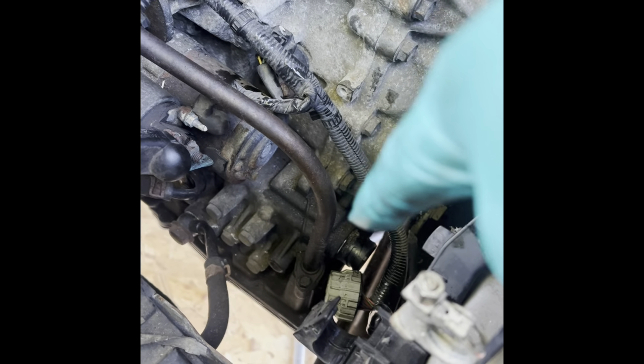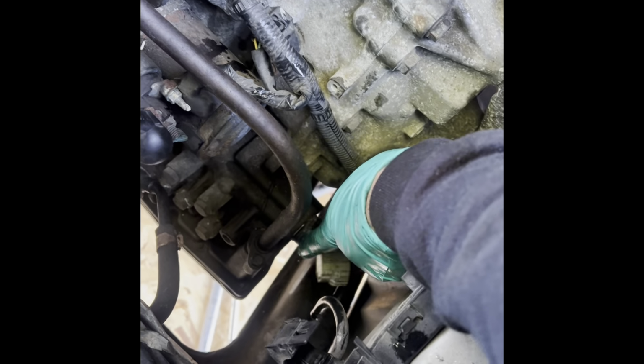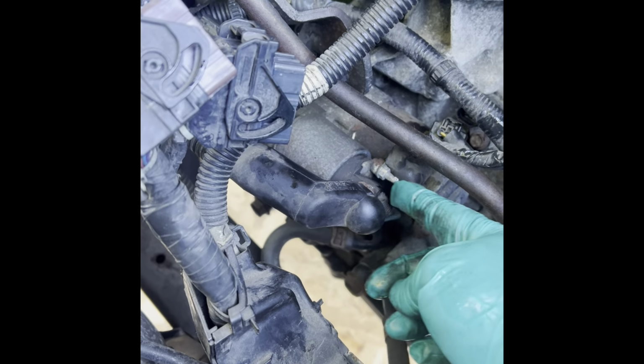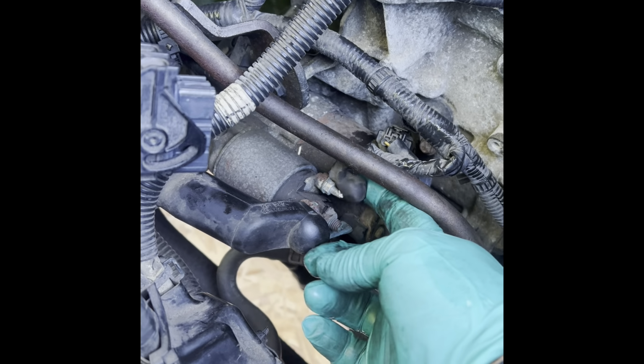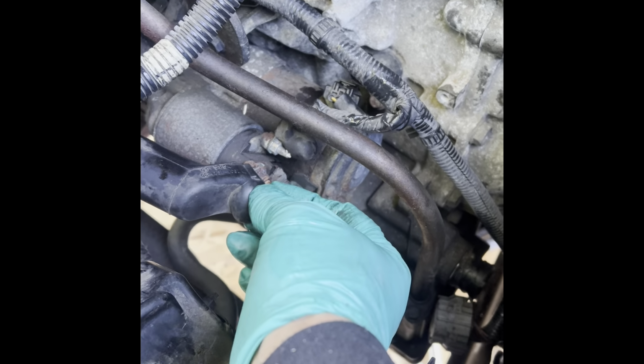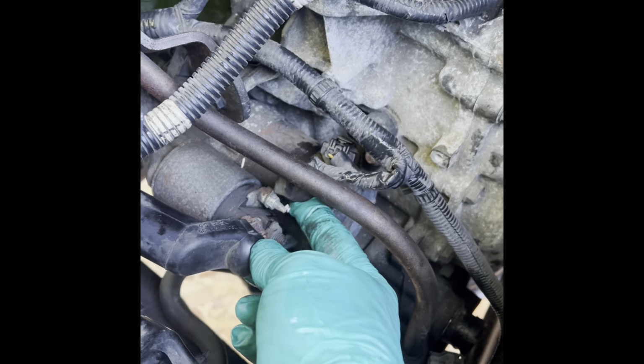So I'm gonna start working on the electrical plug. I started removing that one. That one you turn and it comes out. Turn and pull and it comes out. Then you got another one here. Squeeze and pull. The starter bolts, the starter connections, signal wire and battery connection. It's gonna be like a 12, the big one. And the little one, I think it's gonna be a 10.